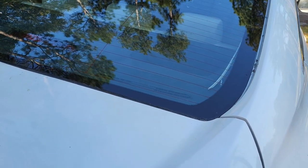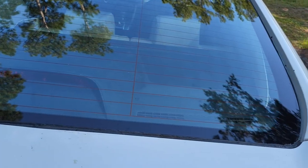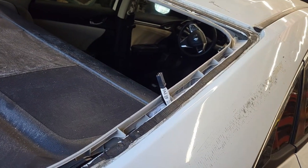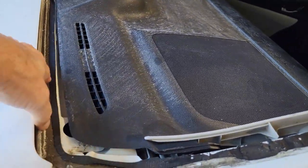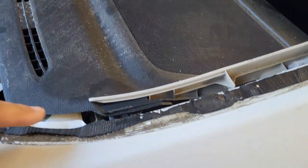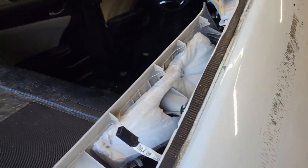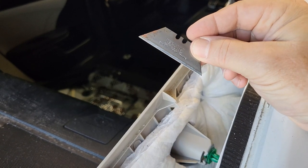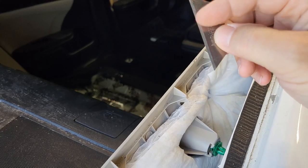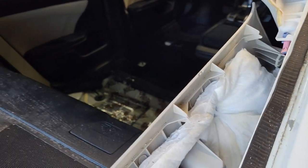That's where it started, and then the video picks up from what I didn't lose. Now that we've got all the excess glass from the broken rear window cleaned up, we need to do a final cleanup. You can see there's dirt from all the years — we want to make sure we have a good seal. We're going to clean up the last little bit of old sealant, just bringing it down flush to the metal. First thing we're going to do is take a razor blade. I've cleaned this razor blade because it's brand new and they'll have oil on it from the manufacturer so it doesn't rust — you can feel it when you grab them.